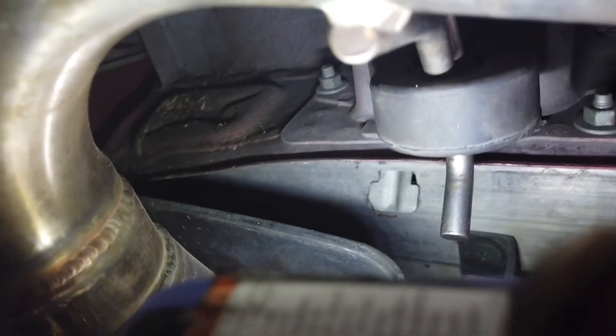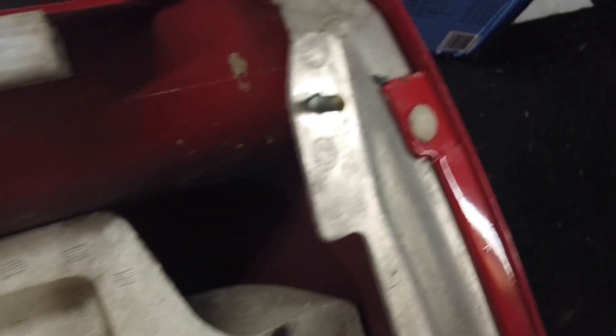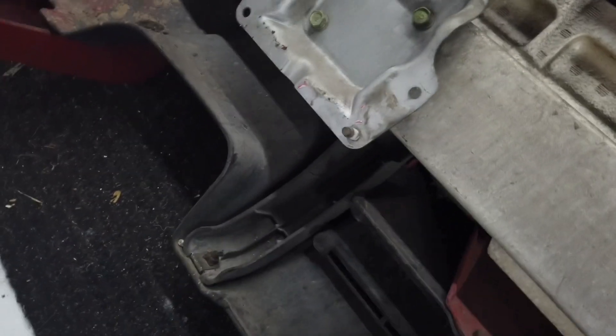Next thing is the crash bar - I'm going to take it off from there and that one up there on both sides. Now we have the bumper off and you can get a better look at where the nuts were - there's a nut there, nut there. These are inside the trunk, and then these are the crash bar ones right there.